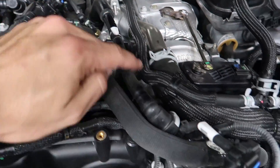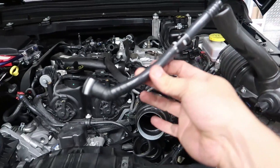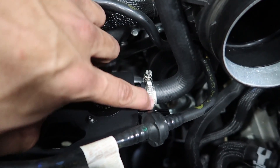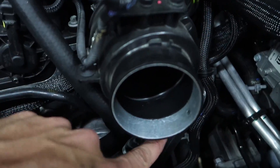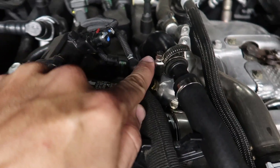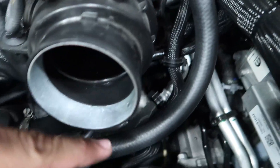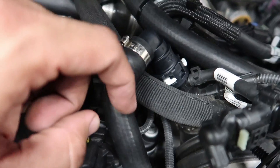Now we need to intercept this hose — it has to be pulled from here and over here, just from this clip. So it's removed from this side, and then on this side you basically just twist it and get it out of the way. Here's the stock pipe — this short pipe just goes like this, then you clip it in here, push the pin, and you're locked in. I really appreciate that this kit comes with German clamps instead of the regular ones — these are way more durable and won't strip. Now we just connect this end all the way around here and connect it into the other side of the intake of the catch can. I got this thing clamped right here, connects to this side, zip tied right here against this heater hose so it doesn't move. Then it loops around here with another zip tie so it doesn't wiggle. Then it's secured right here with one of those nice German clamps, and on this other end it has to go through the catch can and flows right back into the intake with a nice OEM clip.